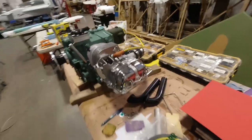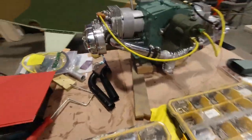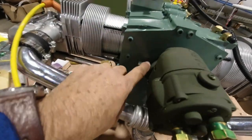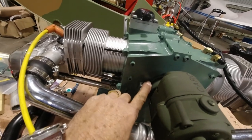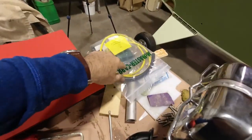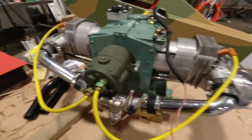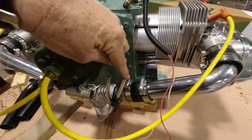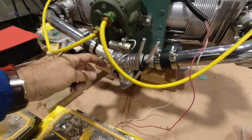Since I picked my engine up and he didn't have to box it, everything is left just like he ran it, which is really nice because my intake is already on. He's already timed it and it's got a couple marks where it's timed to, which is super helpful. In this bag is also the tubing - you connect this one to here and this one to here - and that's where the oil comes and circulates around the intake, which actually doubles as your carb heat. It basically eliminates the need for carb heat.